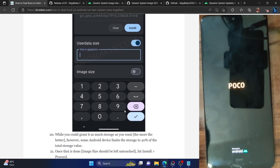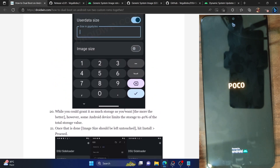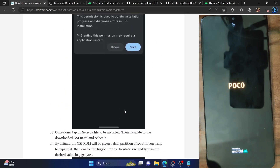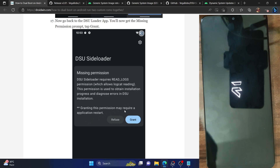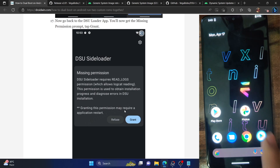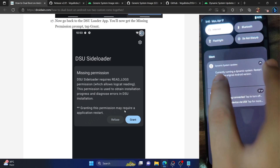Let me now boot the phone to the Evolution X ROM, and after that I'll show you one more ROM to sideload — this time the official Google GSI image file. Do keep in mind that whatever modifications you are carrying out should be done in the base ROM. In my case, all modifications will be done in the Pixel ROM as my base ROM. You should not carry out any customization or system-level tweaks on the second ROM.